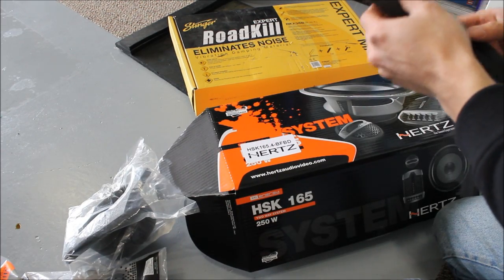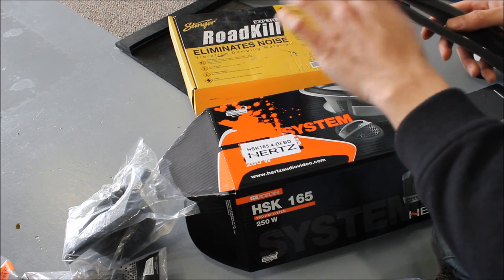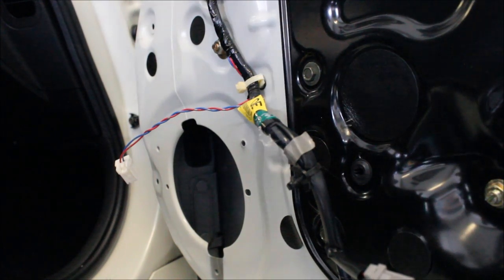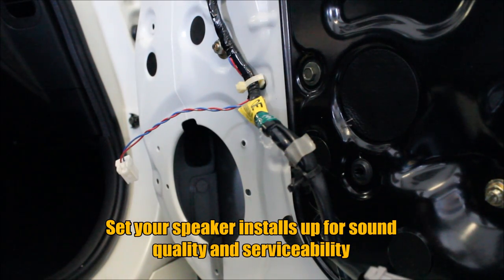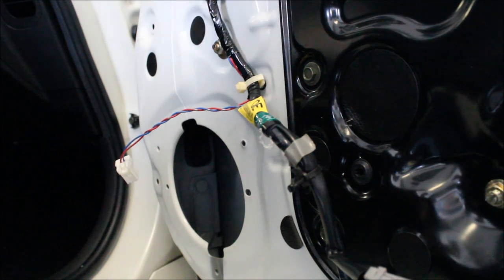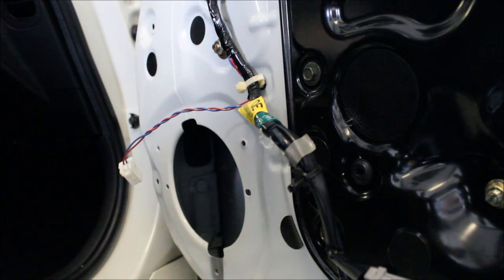After that, we're going to install the speaker baffles. I'm not going to use the speaker baffle itself for an enclosure because the door is really big — I want the door to be the enclosure. We're going to cut it up and use it basically as a water shield so when moisture comes down when it's raining, it's not going to get on our speaker. To finish it all off, we're going to use foam tape — it's going to go on the surround to make sure we focus all the energy coming off the speaker into the cab and not getting lost in the door skin. The way I'm showing you is going to be the easiest because we're not removing the inner cover.